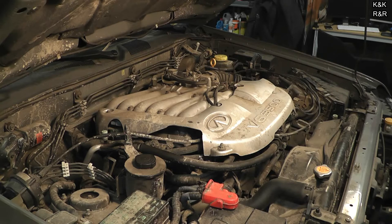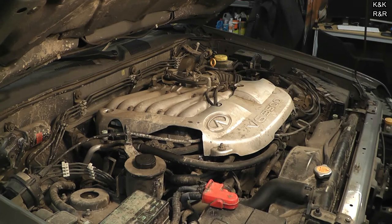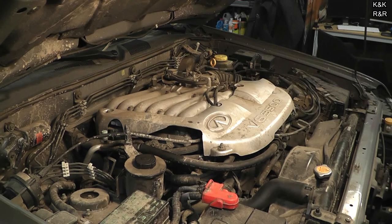So we're tearing the top off and going deep into the 3.5. There is a thermostat buried way back there — the book calls it a water control valve, but it's a thermostat at 203 degrees. This engine is running 170 degrees. There are actually two thermostats on here. If either one doesn't do its job and the engine runs cold, you're dumping fuel. We also put E3 spark plugs in here, and that may have been a little too much spark plug for this engine. While we have everything apart, we're changing the plugs back to factory iridiums — a lot of people who report the super ping problem have had to go back to factory iridiums.